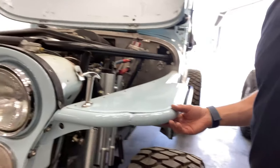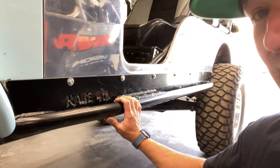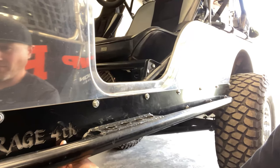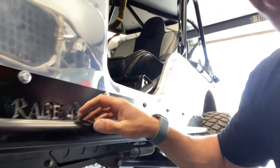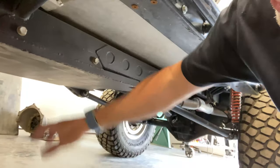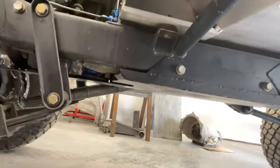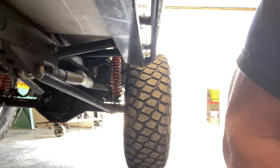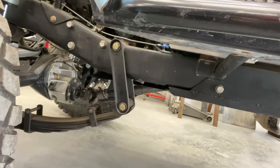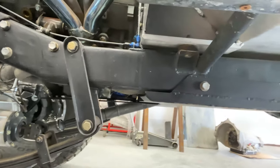I've got Poison Spider fenders — back in the day Larry sent me these, nice to have all steel. I built these Rageforth rocker panels with Mike Schaefer over 10 years ago — angle iron, tube, some dimple die stuff. A lot of the same theory that's in the rockers today. One of the cool things about this Jeep is it's flat underneath. The skid plate bolts in from the side and covers everything, with nothing hanging down until the rear links. The back has a high pinion 9, and the front has a low pinion protected by the leaf springs. The shackles are hung way up above the frame — super long — giving a lot of clearance.